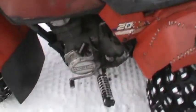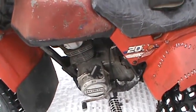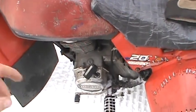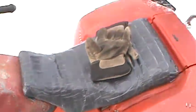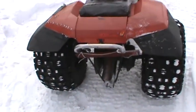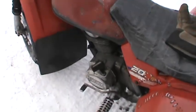With the help of some YouTube videos I got the timing chain adjusted up, because the method the owner's manual tells you to do wasn't working. Turns out you take off the little top bolt and the adjuster — the only one Honda tells you not to mess with — and you can screw a little 3mm by 0.5 thread pitch screw into the actual adjuster itself and manually pull it up if the spring tension isn't working. Basically it just gets stuck in there.